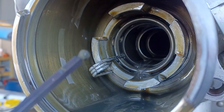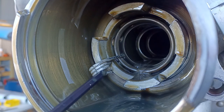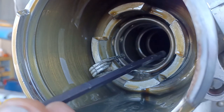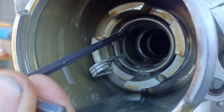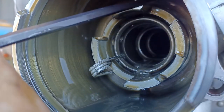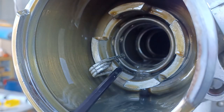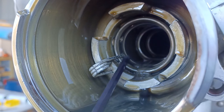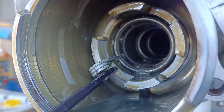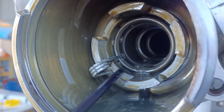The next thing to remove is the safety pin. The safety pin goes through holes drilled in the shaft coming from the engine and holes drilled in the prop nut — this is the prop nut on the outside. The pin actually goes through both the shaft and the prop nut, so when you put it back together you'll need to line those up.